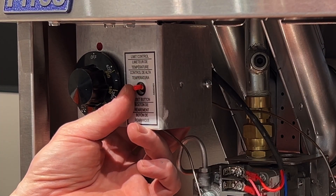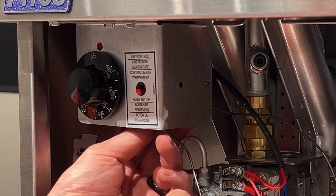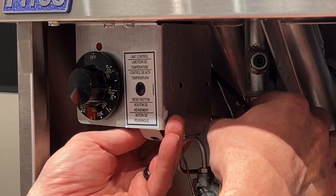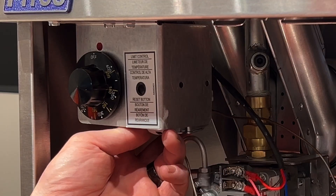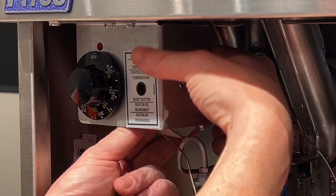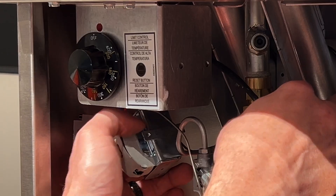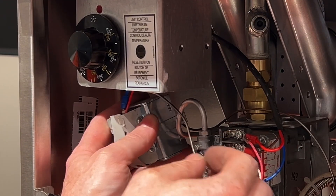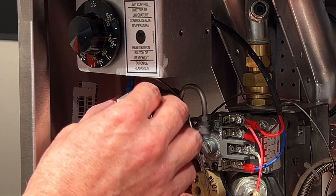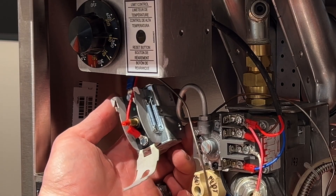I always like to take these out by hand so I don't have to try to find them in a floor drain. When you remove this it's a little bit tricky because you've got this cap tube here that is keeping it in place. If you can't get it this way, it's perfectly acceptable to remove that entire bracket. Now that we've got it dropped, you can see this cardboard cover which is covering up the wires. Just get that out of the way, exposing the two wires.